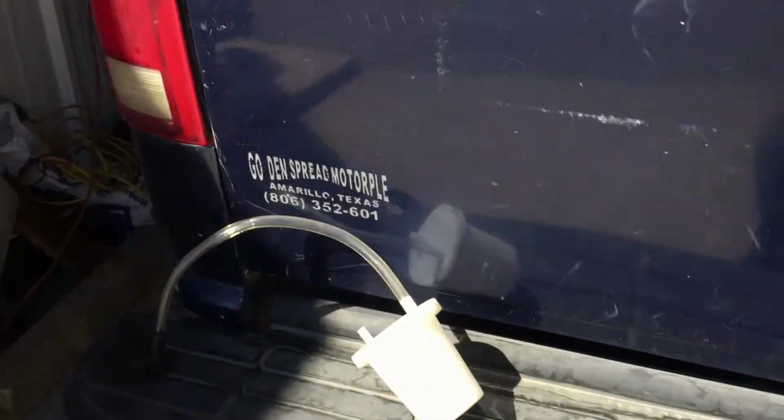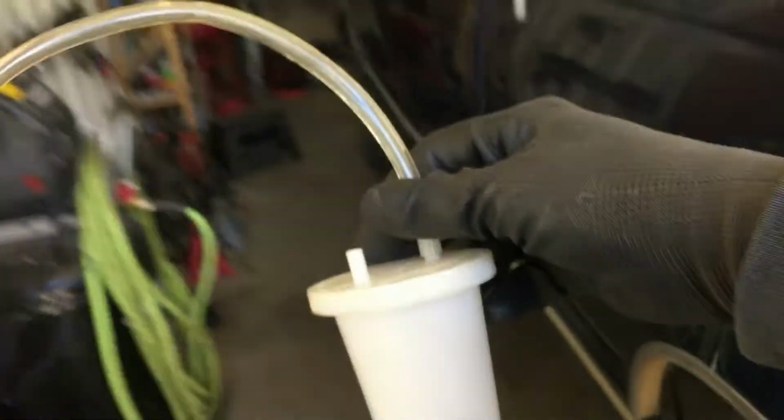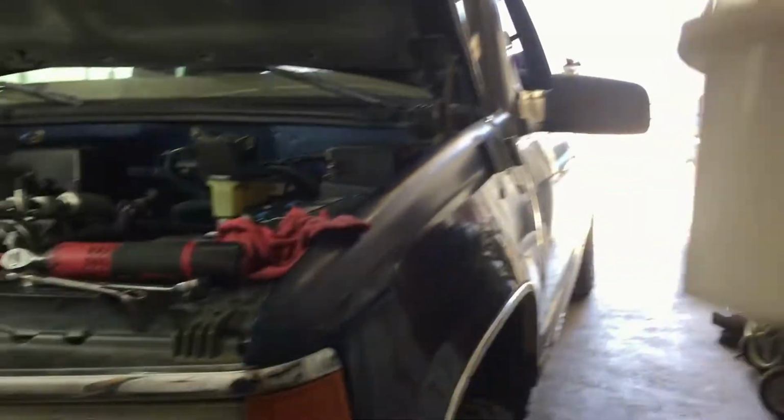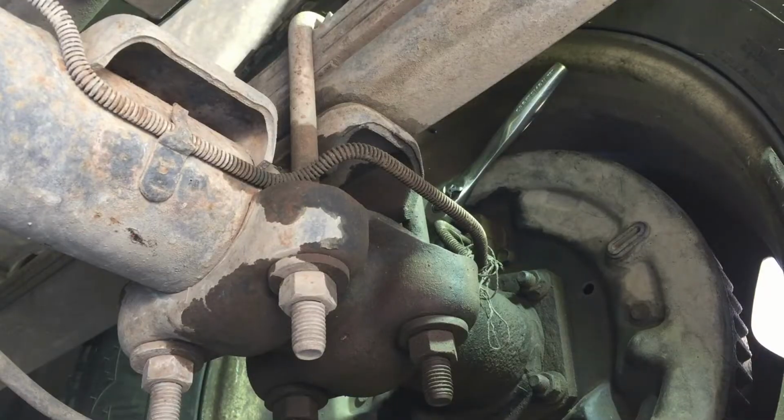since I'm working by myself, I'm gonna use this little bleeder, self bleeder. It's good. It works real good. I mean, it's real cheap, $6, under $10, and you bleed your own vehicle. You're gonna get in there and pump it 4 times, and then you come out, and this will be full with liquid, and you move on to the next one, and I'll show you how it's done.